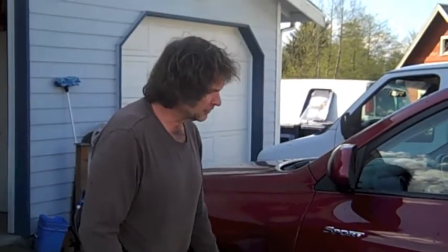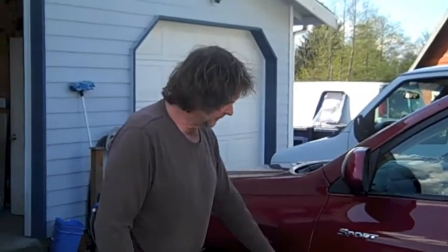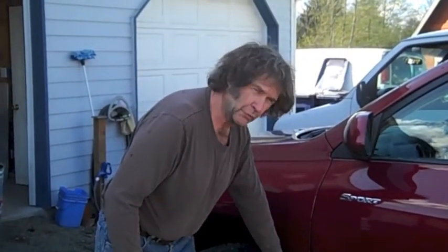And this is a water leak that you can't really tell where it's leaking in when it's assembled. The inner kick panel is disassembled there so that we can show you where the water's leaking in. And it takes a while for that to actually fill up. But once that fills up, it drains out much slower than it comes in. So what it does is it runs over and then it gets the inside of the vehicle wet. So we'll open her up.